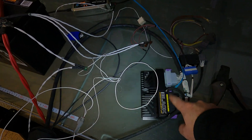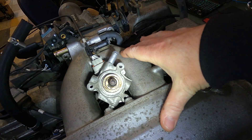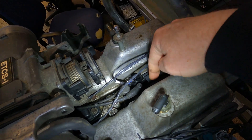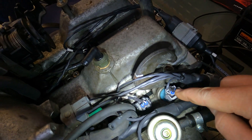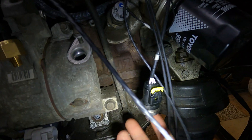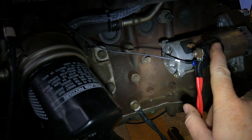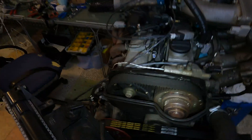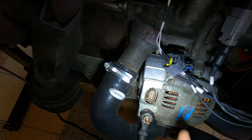So now we've plugged all the ECU in. We've got our map sensor connected to the intake manifold. We've got our intake manifold in here. We've got our idle air control valve so we can show that that's working. We've got a TPS plugged in from our throttle plug. We've got our MAC plugged in that we've already tested and we know that works. We're obviously using the dumb coils - standard 2JZ coils for this test - and we're using the standard 2JZ injectors off of our own testing harness. Coming underneath here we've got our knock harness, our oil harness with oil temp and pressure sensor, our fuel pressure sensor, our oil switch, and starter plugged in. We've got our little adapter harness from our 2JZ GE VVTi coolant temp sensor - it's a little temporary one just so we can test everything is working.